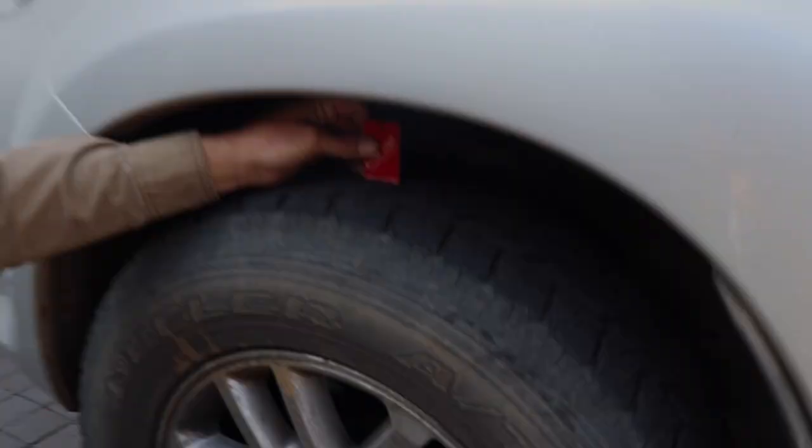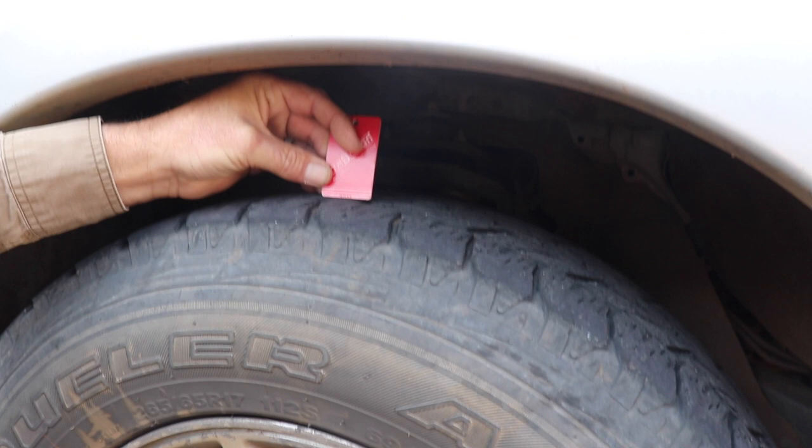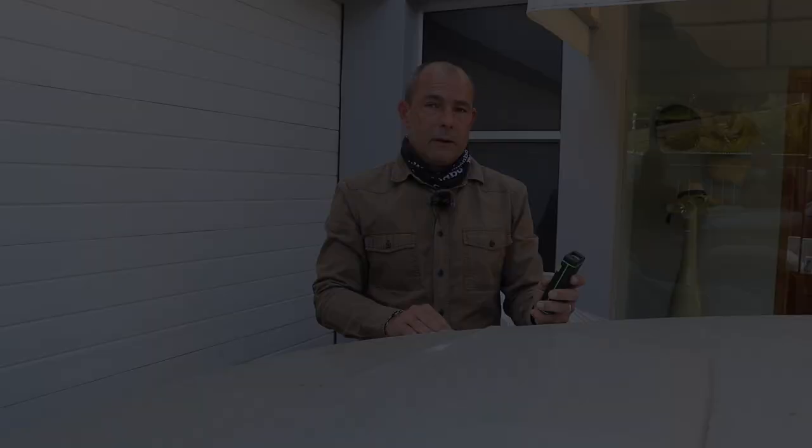When we're doing all of this, we also check your tread depth — it will actually tell you when the tyre needs to be replaced or if it's in a healthy condition. We put this onto the printout, so when we're complete you know the toe, all the different angles, and the condition of your tyres, knowing that you and your family will be safe. We also want to make sure that the wheels are perfectly square — we want the wheels to each be sitting on a perfect corner. To do that, we use a gauge that measures the distance between the tyres on either side, does all the maths for us, and we know the results are accurate.